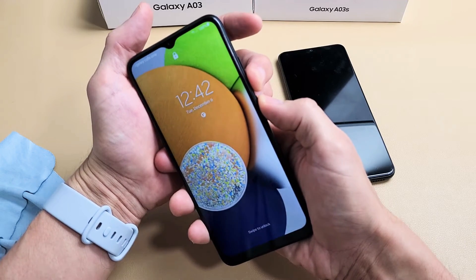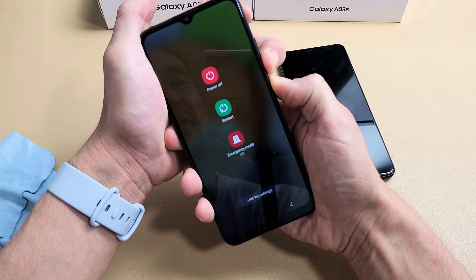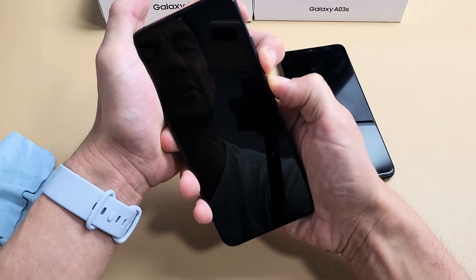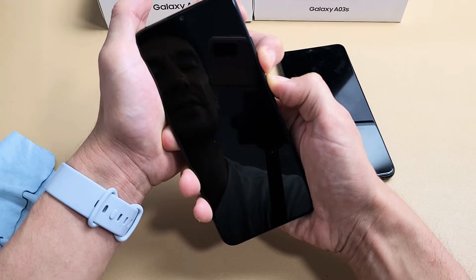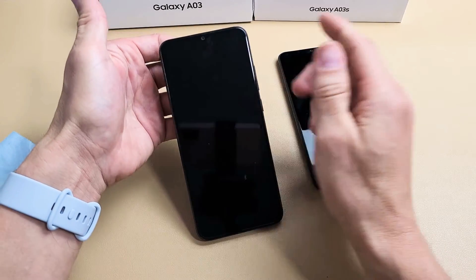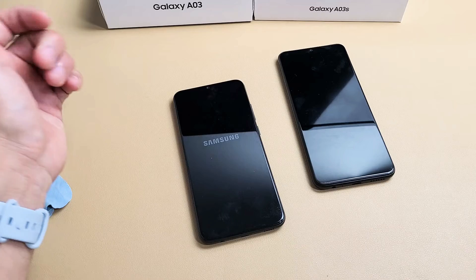After tapping, turn your phone over, tap the power button, and see if you're still stuck in a boot loop. If you still are, again do Volume Down and Power — press and hold, and do not let go until the Samsung logo appears. Once it does, let go, and hopefully that gets you out of the boot loop. If not, we'll go to the next possible solution.